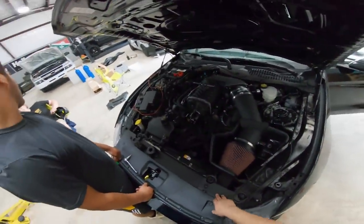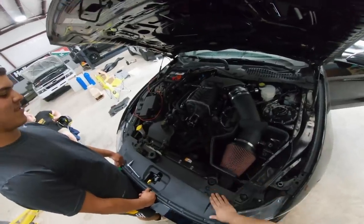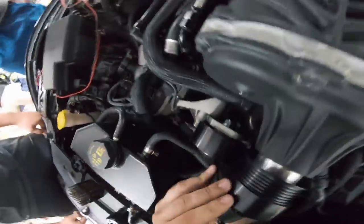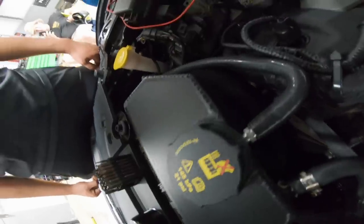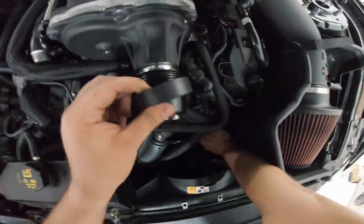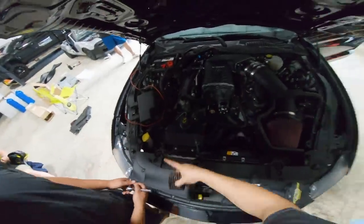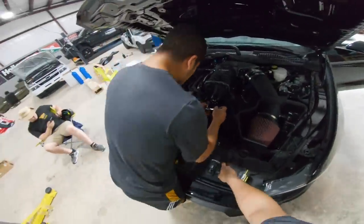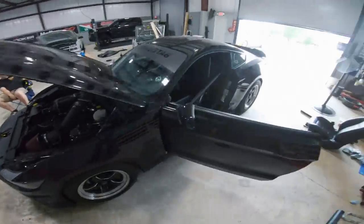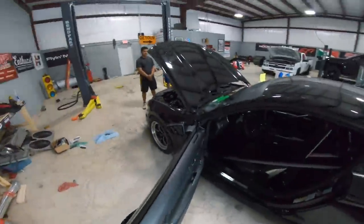Great. Oh, yeah. So anyways, we're gonna finish putting the pulley on here, and actually we're pretty much done. I've done this exact thing. It's gonna be harder to put that belt on now, huh? A little bit, but it's the same. This belt will fit a few different sizes because of this tensioner. Shout out VMP again. There we go. Just tighten those up. Be very careful though. I'm serious, those bolts will shear off. I've sheared one or two, as you know how my tightening goes. I'm gonna start it real fast and then turn it off, just make sure that it's actually on track.